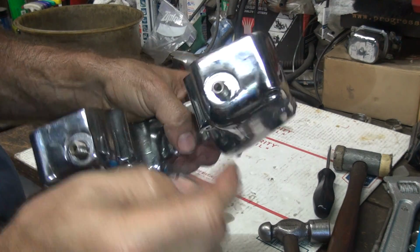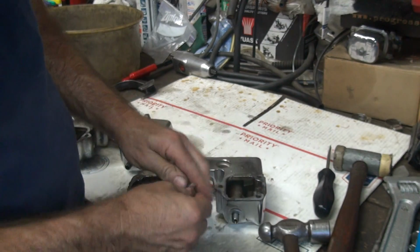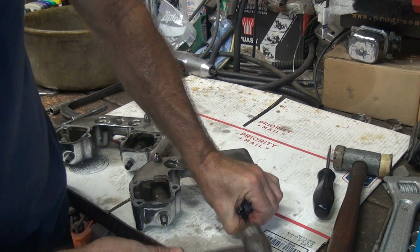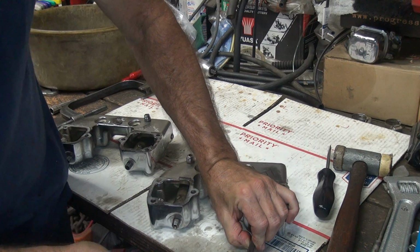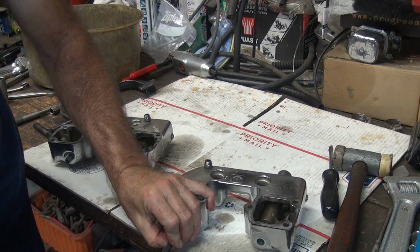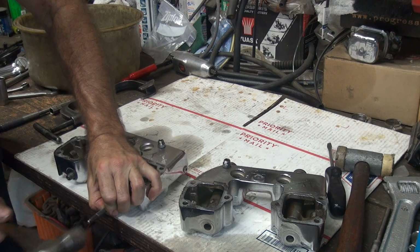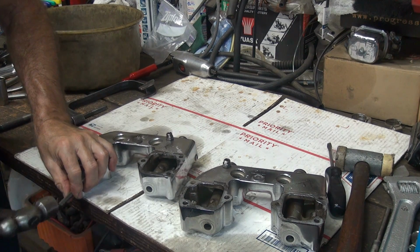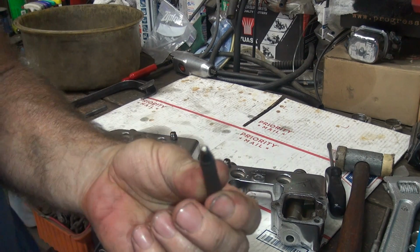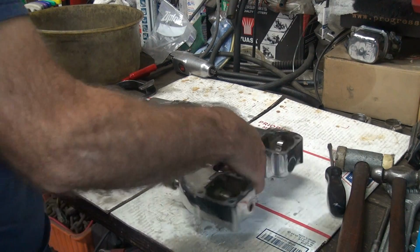And I push it on here and it hits right here in the taper in the middle. It pushes evenly on it and knocks it right out. And it rarely ever swedges it bigger so it doesn't come out. And it doesn't hurt the shaft at all, which is kind of important. So anyway, it does no damage, which is a good thing.